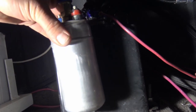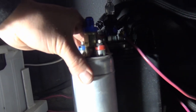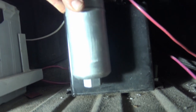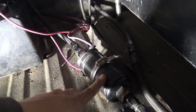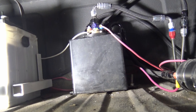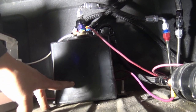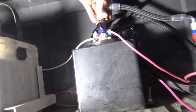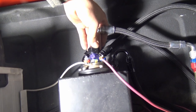This surge tank isn't very big. This is what a Bosch 044 looks like — as you can see, if we set it right about where it sits in the tank, it almost touches the bottom of the tank. This pump right here is gonna always feed our surge tank, and if for whatever reason our surge tank goes low, this pump that is feeding our rails always has fuel — so it will never, ever starve.